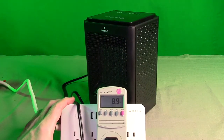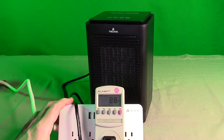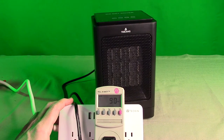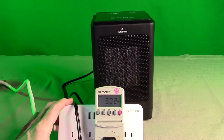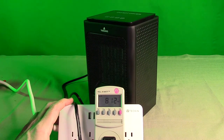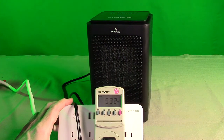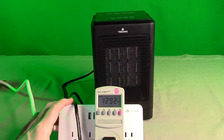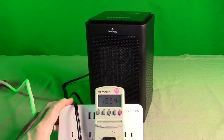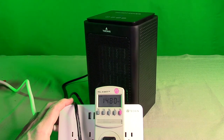So here I have a watt meter going, just out of curiosity. I have it rotating and on just the cool setting, and you can see it's drawing 9 watts. Now I'm going to put the first level of heat, and you see it jumping up to the higher setting, showing about 800 watts. Now I'm going to go on the highest heat setting, and now you see the watt meter shows the wattage going up to almost 1600 watts. It's going to stabilize and drop down a little bit, but it's showing the three different levels of power that this unit has.